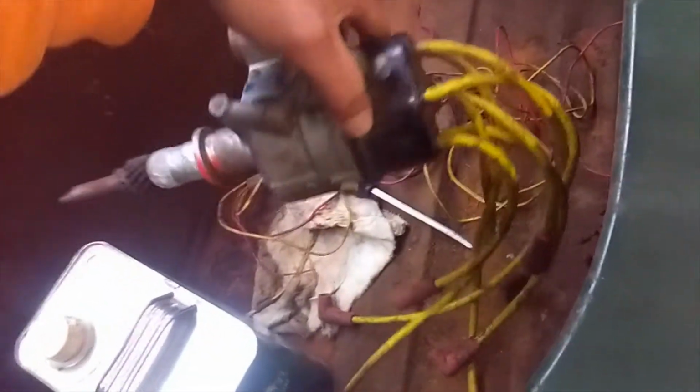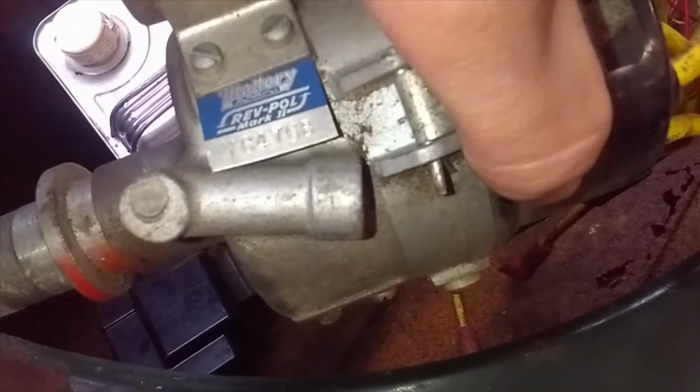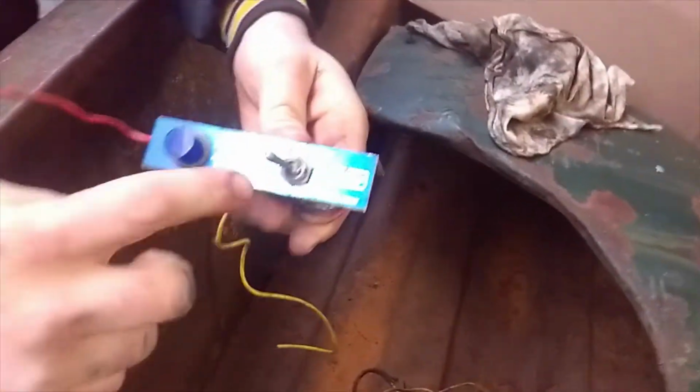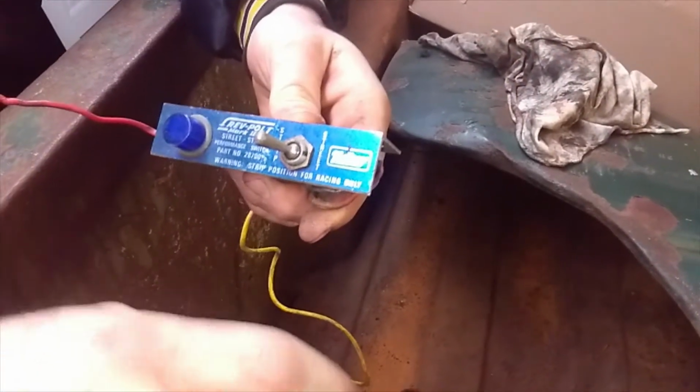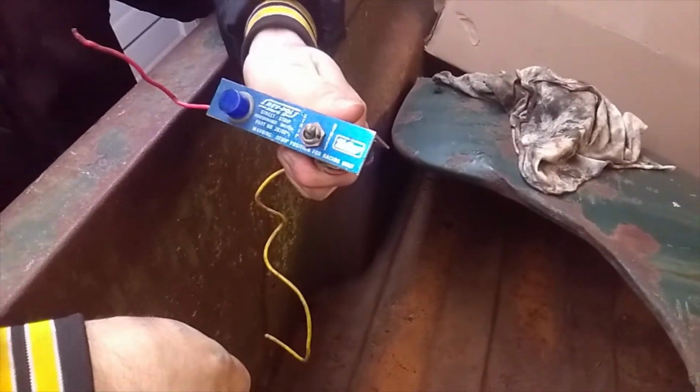This was what got my attention. The Magneto distributor. Yeah. 292. Yep. Mallory. The other thing that's really cool about it is it's got this fancy switch for the strip and the street. When you're running on the street, it doesn't send quite as much voltage through it. So you would switch it over to street application.